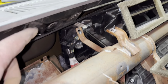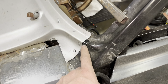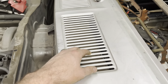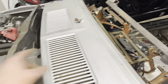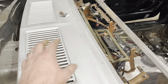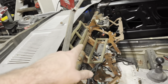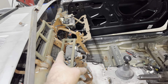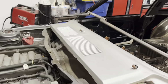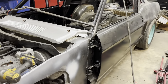I'm going to get the wipers screwed in everywhere they need to go and get the throw on them correct so that they function like they should. When they all function like they should with this bracket in place, that's when I'll take this top piece off the cowl panel, weld the bottom one exactly where it is, and make all the inner structure so that this air vent will still function. Air will be coming in — fresh air mode will bring air in through the vents and through the filter box. I'm not going to block those up. If you do recirculation mode it'll cut the box off and recirculate the air in the car; fresh air mode these vents will be able to work.